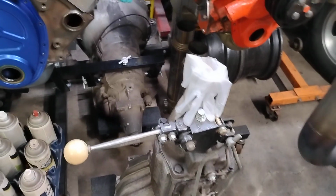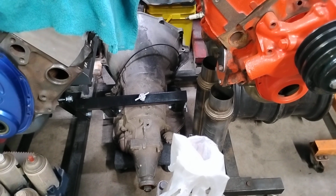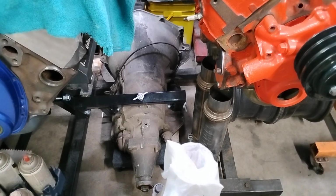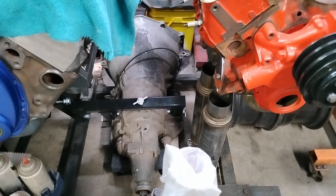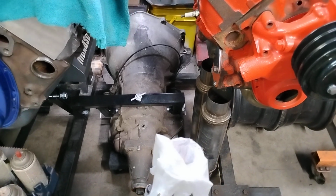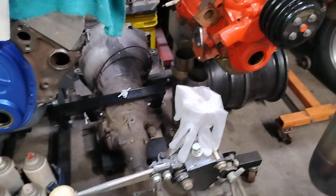I'll probably end up just building that 350 turbo there with some red frictions and Kolene steels and good sprag and a manual valve body. Good torque converter. Got a BTE 5000 stall converter. The 8-inch. So I might just stick that in it. Plus I already have a tubular cross member made for a 350 turbo.